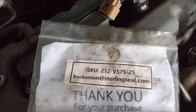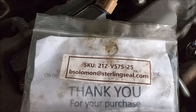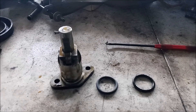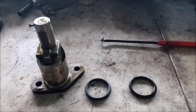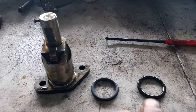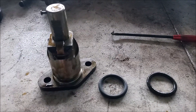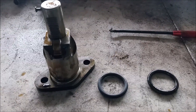You can buy these on Amazon and I'm going to provide you with a link to purchase these O-rings directly. Here is the old O-ring and the new O-ring side by side — you don't see much of a difference. The main thing you should know is that the original O-ring is a metric O-ring, and the replacement O-ring that seals a little bit better is a SAE O-ring.